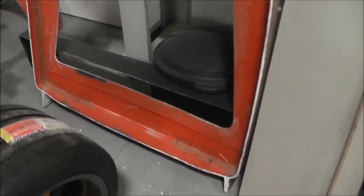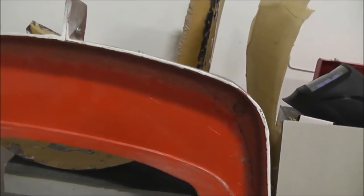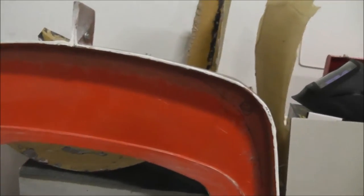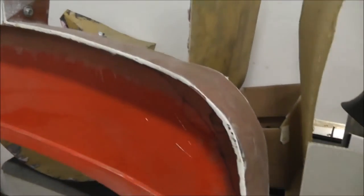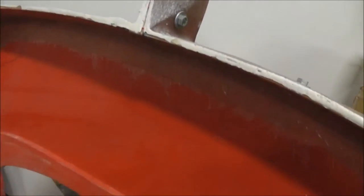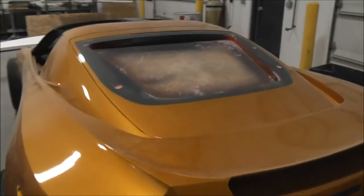There's the mold that I made off of it. It's a one, two, three, four piece mold — the flanges and three pieces in the main piece. There's some glass in there right now because I've laid something so we'll make a flange so that weather stripping can go on to it and it will seal.